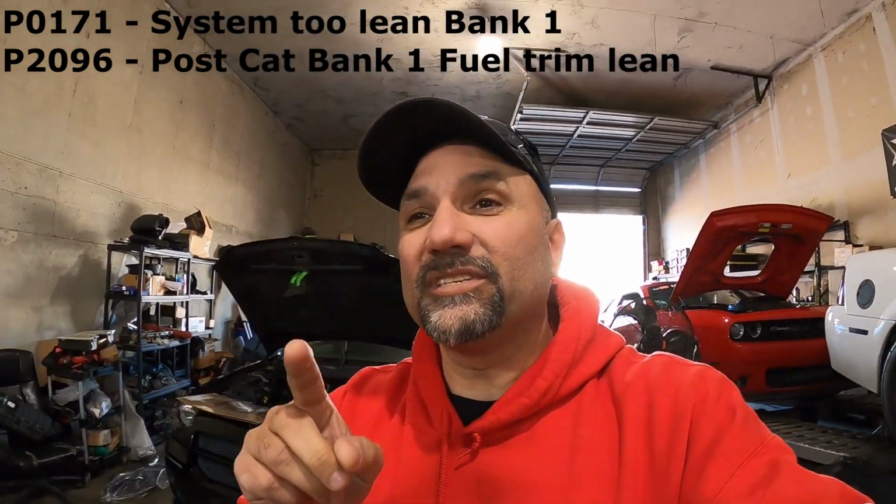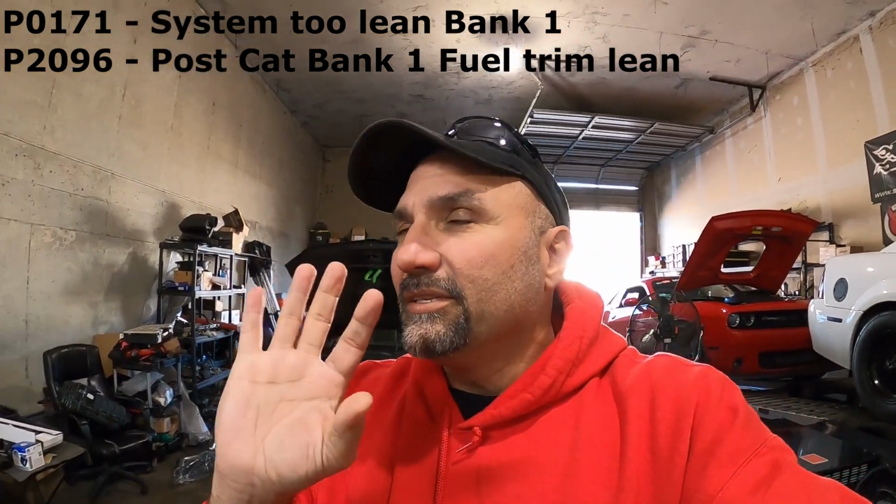So again, those codes 171, 174, not so much. That's really rare. I get it every once in a while. And then 2096, which are all lean condition codes. You need to reposition your exhaust too, just so you know. So I need to reposition my exhaust too.